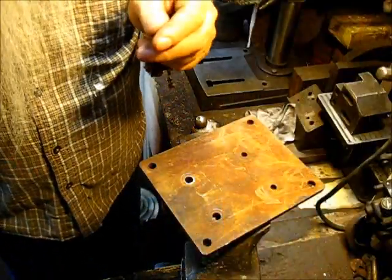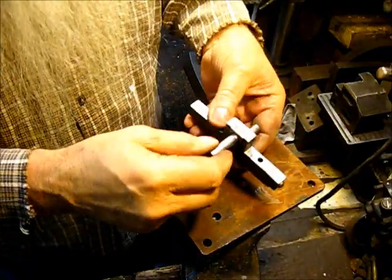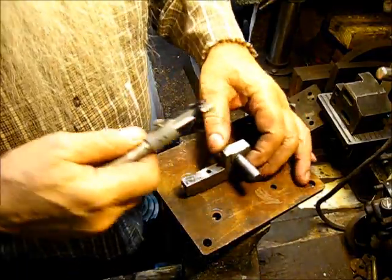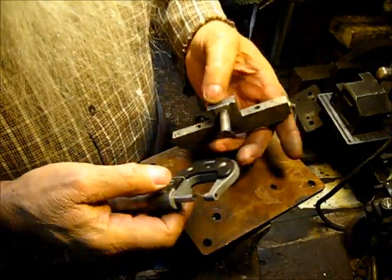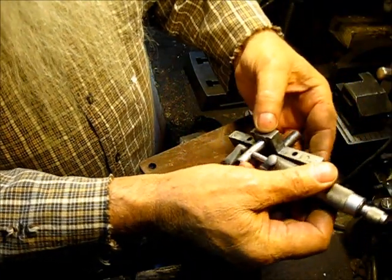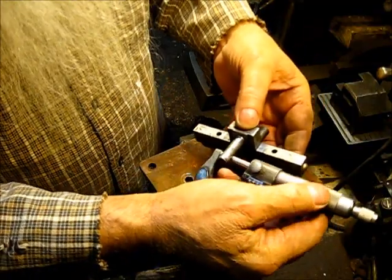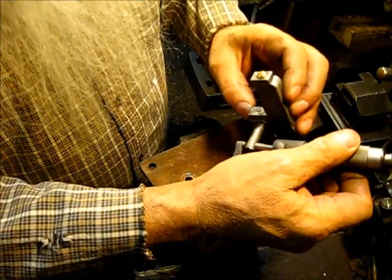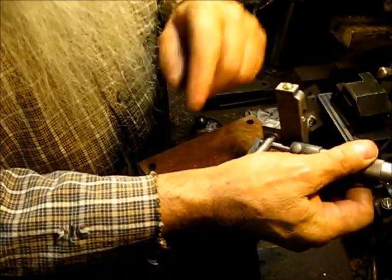Well, let's see, probably should start right here. The guide pin, guide rod, some manuals say that's a guide rod right there. If you're looking at this one right here in hand and you put the micrometer on it, about right there, that measurement is 370 thousandths. Right up there at the top, that's 372, and close to the bottom, that's 373. And if you come backwards like this, 373 in the middle, and down at the bottom on that side is 372.